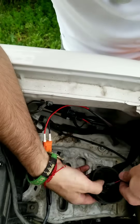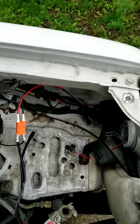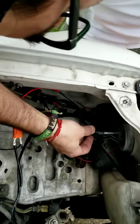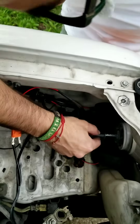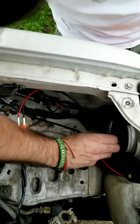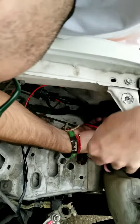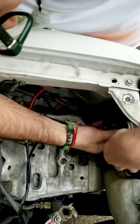There's a rubber grommet that will waterproof your headlight — go ahead and feed your wires through that and slide it up into the back of the headlight. If you haven't done so already, go ahead and insert your bulb into the back of the housing. There's a tiny little metal piece that holds the bulb in there. It's not the easiest to install once the headlight has already been installed in the vehicle — should have thought this one through more.